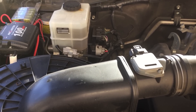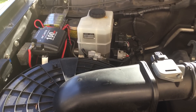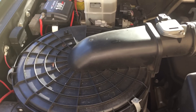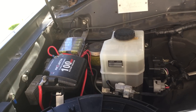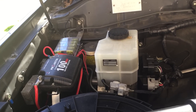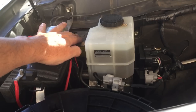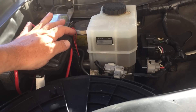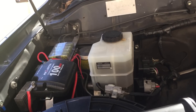The diagnostic brought up an accumulator fault. For those that don't know what an accumulator is: older vehicles had a brake booster to give you pressure when driving. These vehicles more or less use a cylinder which holds pressure, a manual pump underneath it, and a small 12-volt motor.